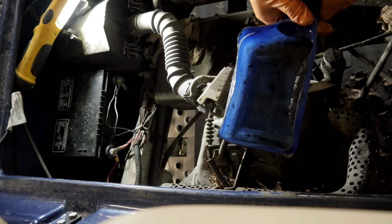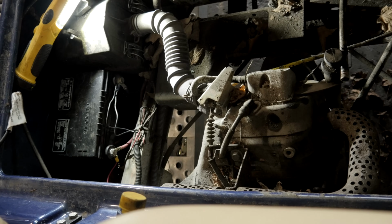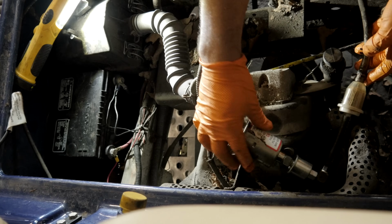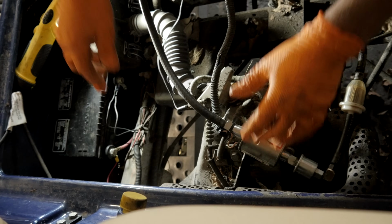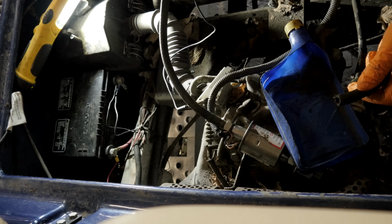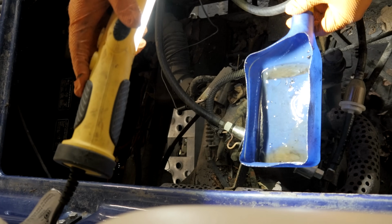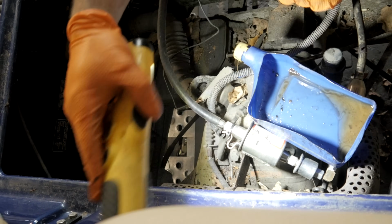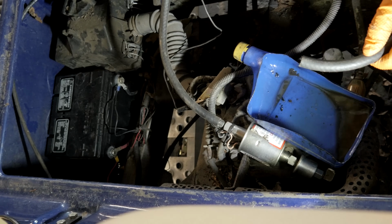All right, so we got to pump this fuel system down a little bit because I can't let it run like that, there's not fuel in it. He's probably going to need a fuel pump. So what I'm going to do is put my electric pump on, so I'm going to keep everything in the fuel system intact. Slip this over here, and I'll hook it up. So you could already see it. See the scum? It stinks like you wouldn't believe. Like rotten, decaying, just not something you would really want to be breathing, let alone put in your engine.